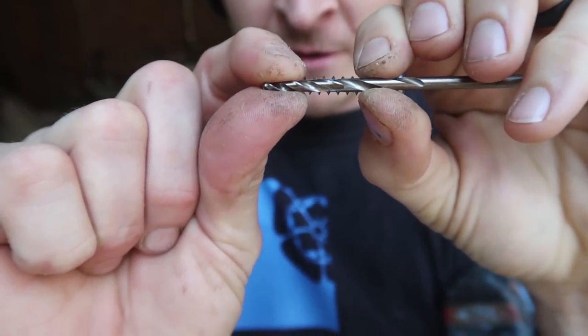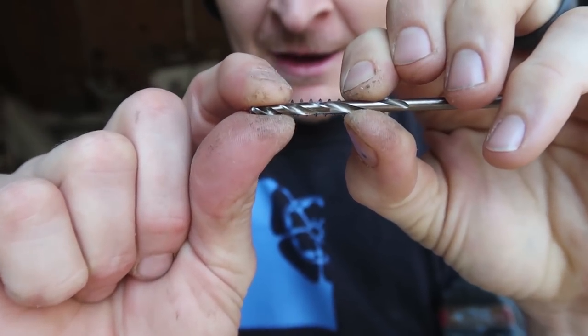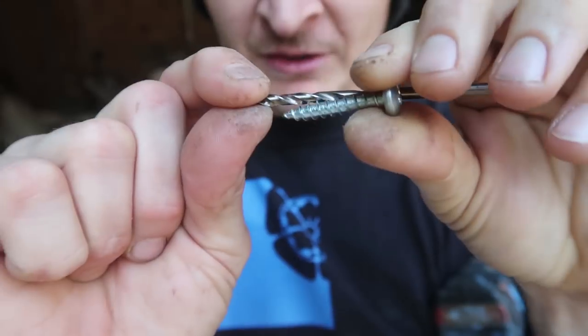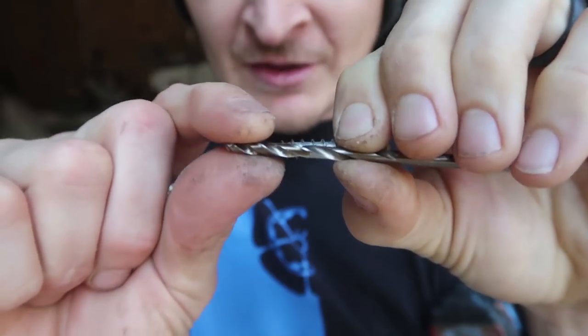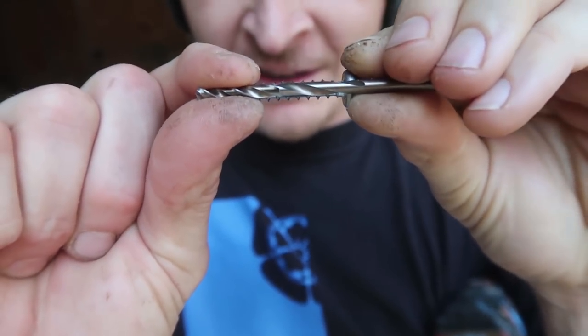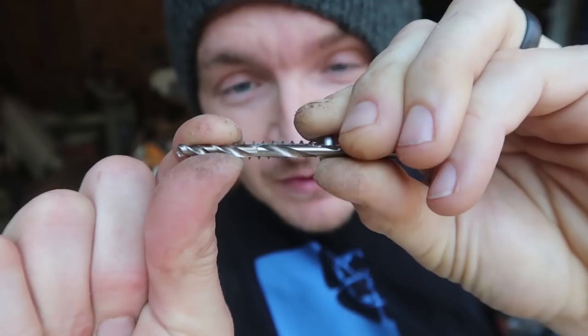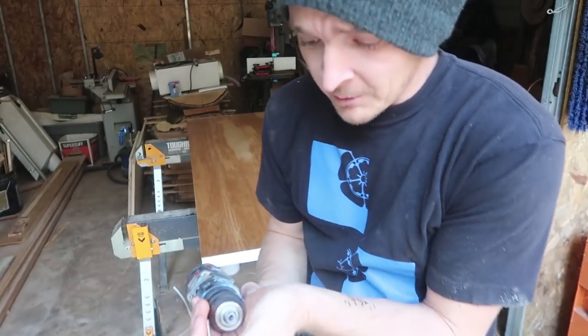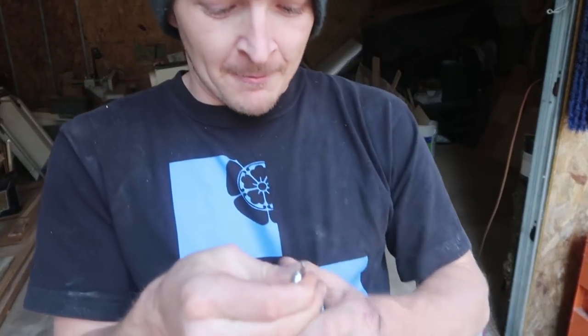The way I picked this drill bit — I just held the drill bit up to the screw. I'm trying to get it so the drill bit is as big as the shaft of the screw. At the same time you don't want to make it so big that the teeth don't bite in — you can see the teeth will go on either side but the shaft will clear out most of it. The depth isn't going to matter much.